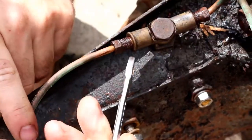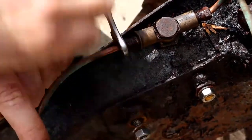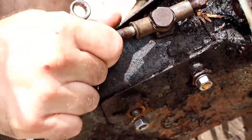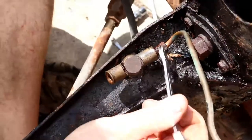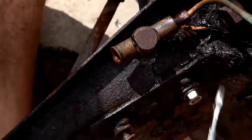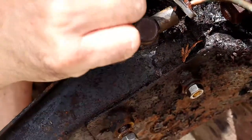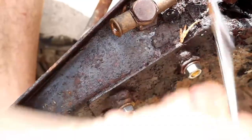This one's coming undone — this is the one that goes from either side. What you might find with brake pipes is a little job turns a lot more complicated. On this one, as I turn the nut, the pipe is turning as well, and it's fairly well seized in there. So what I'm probably going to find is that it's going to twist and then shear off. It might free itself — and yes, it has freed itself, but it's still very tight. Like I say, I am renewing all the pipes.